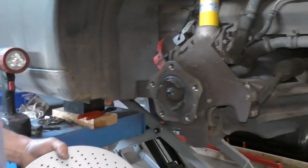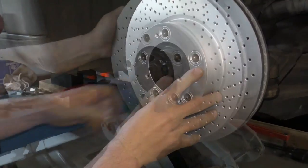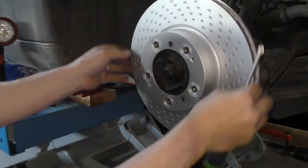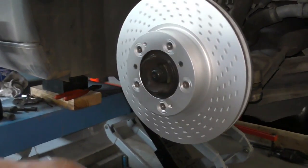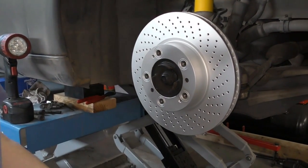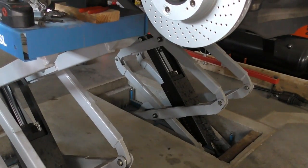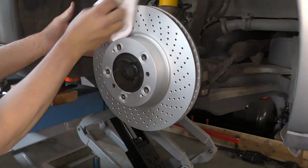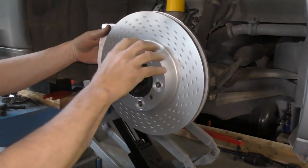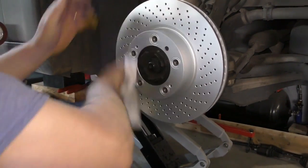When I put my new brake rotor on, it'll line up the two mounting screws with the two mounting screws on the hub. Then I want to turn my rotor and make sure it's not hitting anything — it should turn quietly and smoothly, shouldn't hit the backing plate, no scraping sounds. Normally at this stage I want to wipe down the brake rotor. Most of the time new ones will come with some kind of grease or a light film on them, even when they're plated like this one. I'm just using brake cleaner, and I want to make sure I remove any contaminants from both the inside and outside surface. I also want to take all my fingerprints away — any contaminations on the brake rotor can contaminate the brake pad and reduce braking efficiency.